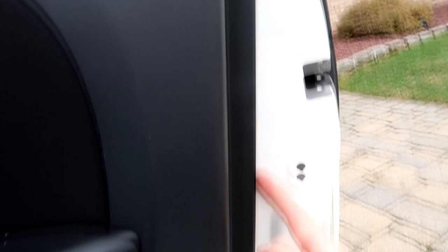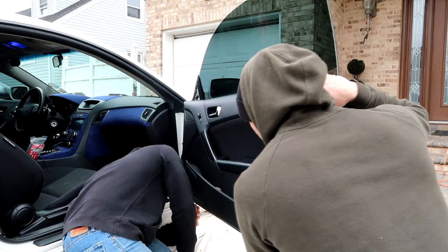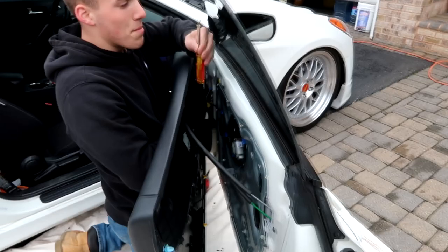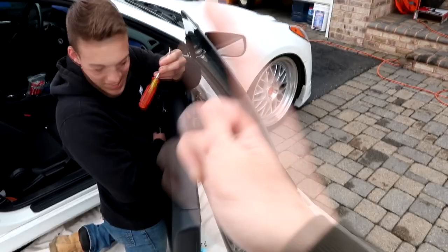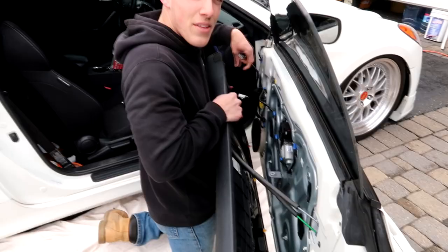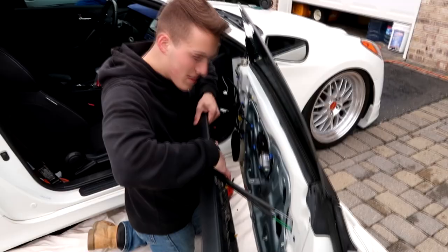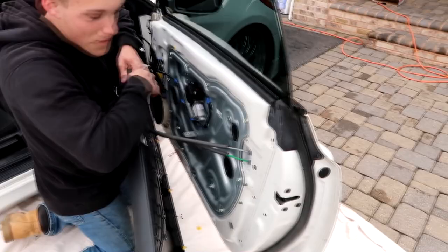I have a little panel popper over there. You're going to have to go all along here — there are pop clips going all along the bottom of the door and all up around here. So once the door panel is off, you want to be careful and not rip it out because there's a little wire stuck to the back of it. This is my little panel popper tool — really, really great investment, almost a pro tip. Once that's out, you've got your little clips back here. You want to make sure you unplug them. This side only has two wires to disconnect versus the driver side, which has like four or five pieces on the back.